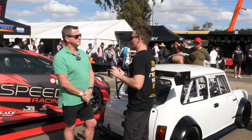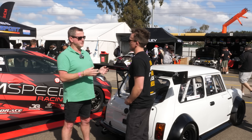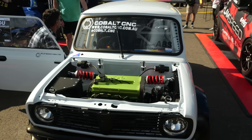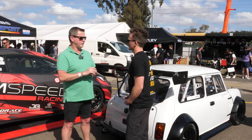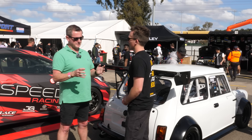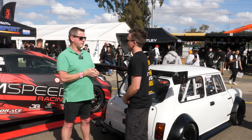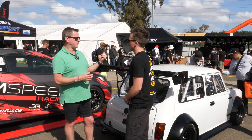To get some figures: a good built KAD engine should pull somewhere between 150 and 200 horsepower. We're running 1430cc displacement, which is a fair pickup over the original 1275. We're running the larger version of the KAD head in terms of valves and cam, and the head has been modified and flowed by Jake Bain from Bain Racing — anyone in the drag racing or motorsport industry knows Jake Bain, they call him 'the little professor.' He knows flow rates and flow dynamics inside out.